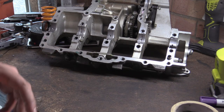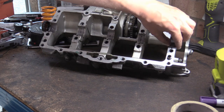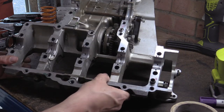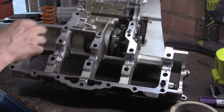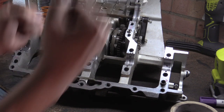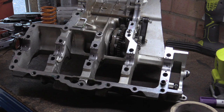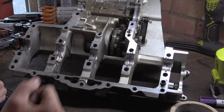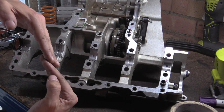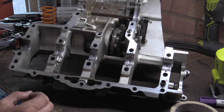You might think, well how come it's for cooling? In our setup, all our bearings are supporting the weight of the shaft all the way across. So you'd think it's equally distributing the load across all these bearings. However, for the end bearings, we have that rocking couple where one piston's up and one piston's down. That's an extra element in that. So these end bearings have to deal with not just the applied load but also this rocking couple, which basically lifts one side of the shaft out, squishes all the oil out, then quick reverse - a flip reverse. This puts a lot of stress on the oil.